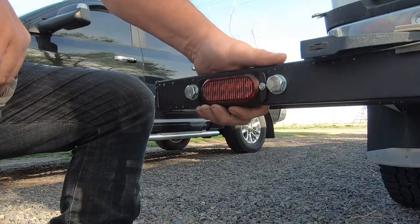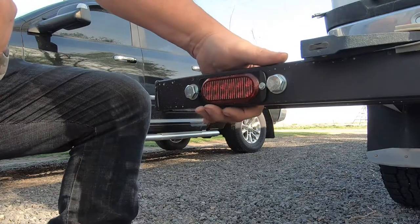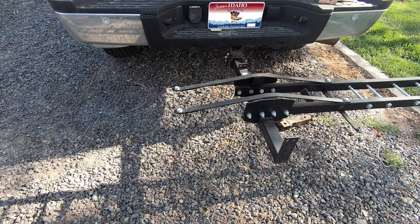After I drive the screw home I awkwardly caress the edge of the light and carrier to make sure it's flush before driving the next screw. After both lights are mocked up I undo everything I did and take off one of the side rails so I can run the wire. But first I drill a hole here for the wire from the trailer plug to go into and install a grommet to protect it.